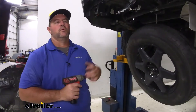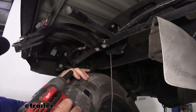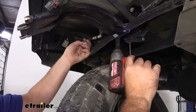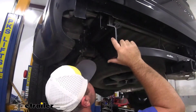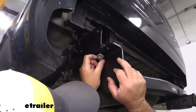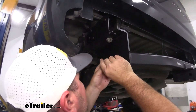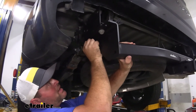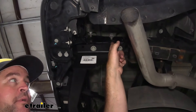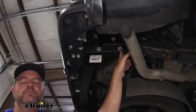Once you have your bumper and receiver removed, lower the spare tire to gain access to the two bolts right here. Use a half-inch socket to remove those two bolts and then remove the plate. Raise your hitch up into place, take the factory hardware, and install it in the bottom two holes first — get one on each side. That will hold the hitch up in place while you install the remaining hardware as well as the rear bumper. Once your hitch is installed, go ahead and reinstall your bumper. Get these bolts at least halfway in, then come back and tighten and torque them to the specifications in the instructions.